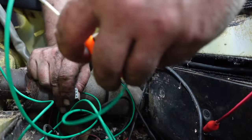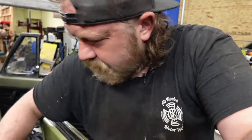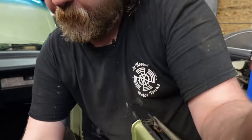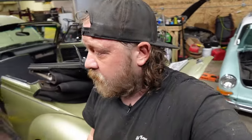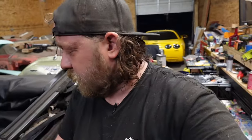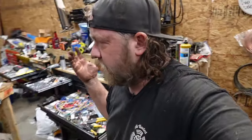But that's pump. So this is off the ignition. That's the green wire I ran for the ignition. So I'm gonna cut that, splice that in with the fuel pump, solder them together, heat shrink them, all that happy horse stuff. And now that line will power forward because it doesn't need to go to the relay anymore. I could cut that terminal and splice them all together and make it all good, but I'm not, just in case they want to use it for something. Got it far enough back to where you can splice it together if you need to. So let me get that done.